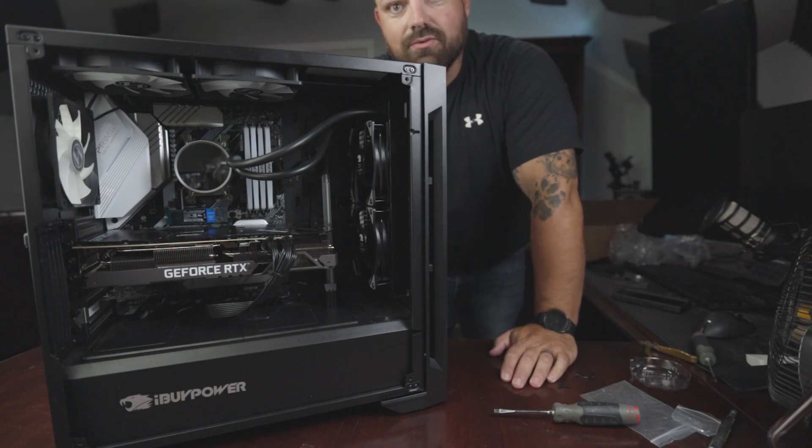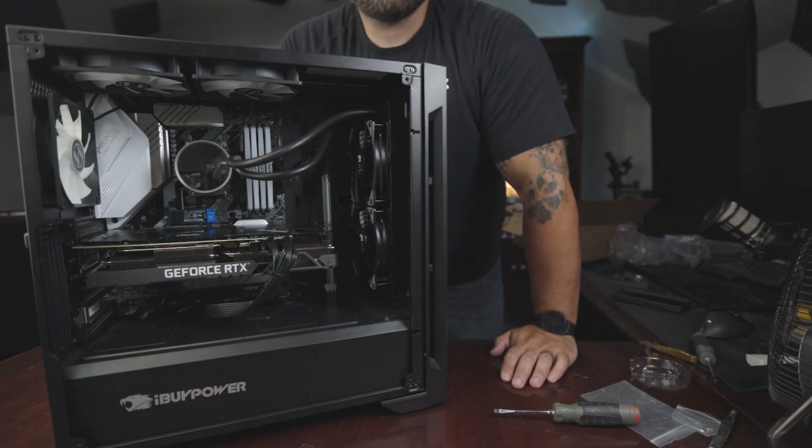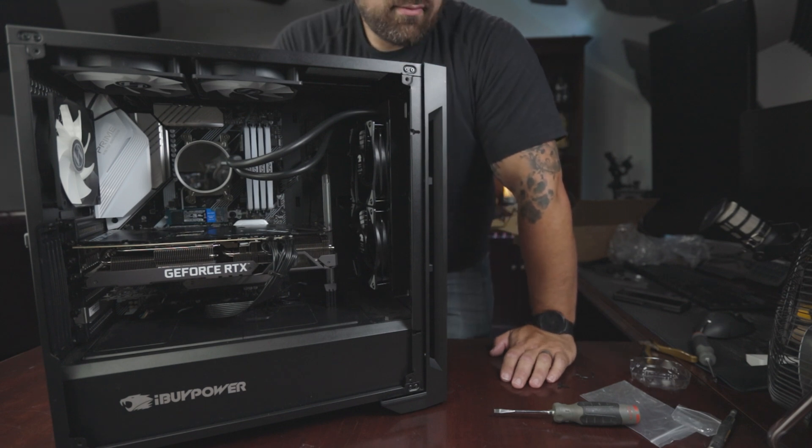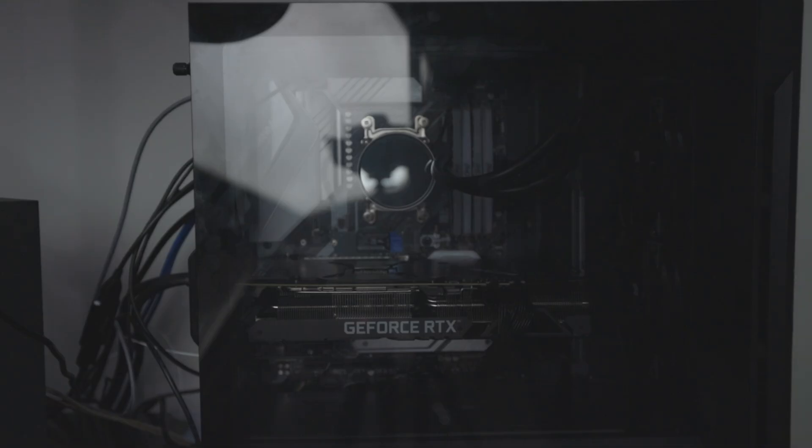She's all back together. There's nothing left to do other than power it up and see what happens. The best thing to do is boot into the BIOS and check the temperatures there — make sure nothing goes crazy. I've got mine limited right now, but if it looks okay I'll set it back to auto. Right now I've got mine set at 90, so it won't let the CPU go over 90 degrees — it'll start throttling harder. Alright, moment of truth — let's see if it boots up.